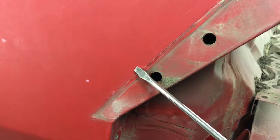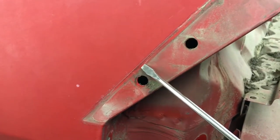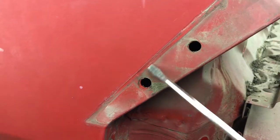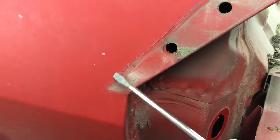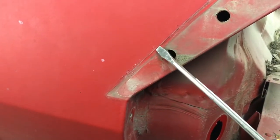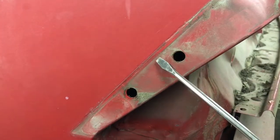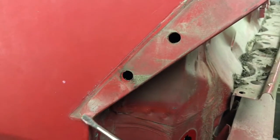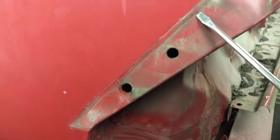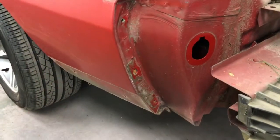You can see where the paint starts to chip back right here — that's the actual paint line. You can feel it. They painted right up to the edge, which is not good for longevity. It'll start to chip back, and the paint will actually shrink — believe it or not — and you'll see a gap between the piece you painted against. Once it gets really brittle or dry, it'll start to crack, delaminate, and pop off.